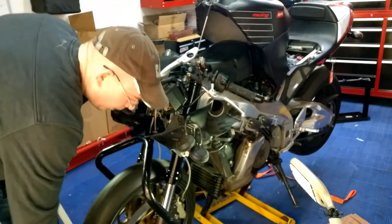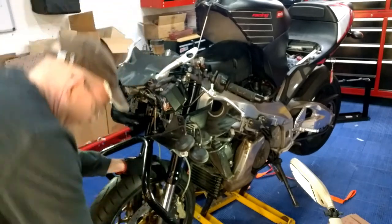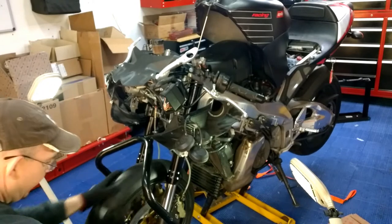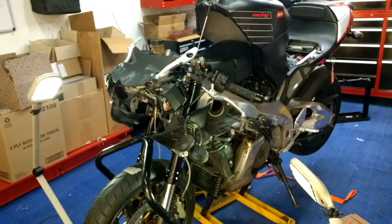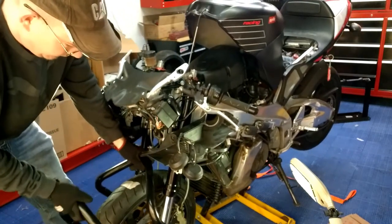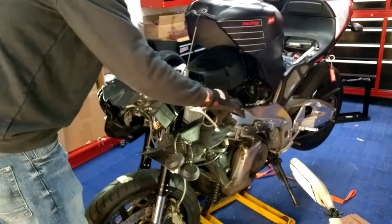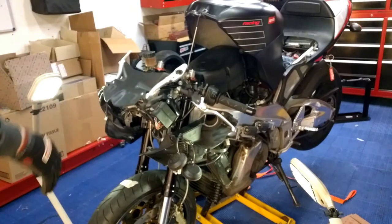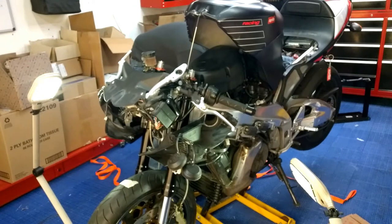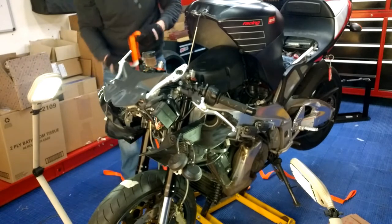I'll tell you what — it sounds like I've got one pad that's dragging on here. It's not allowing that tire — it's all over here on this right side. It's not applying pressure but I can hear it dragging. I'll kind of address that when I go to change the pads. But this little stand here, I will probably never use that thing again. And just remember to go back and torque all your bolts back to spec. I've already had this thing fall once — I don't want it to fall again, for God's sake.